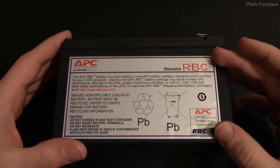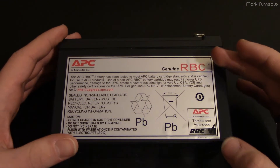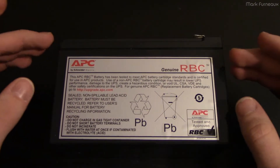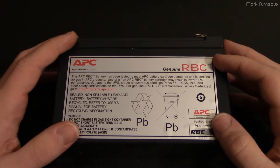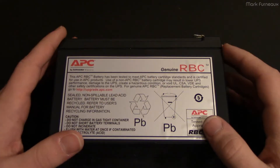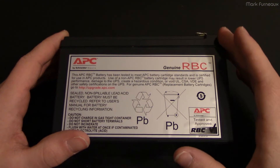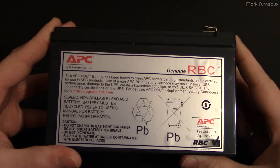What I'm more a fan of is to take the battery out, replace it with a known good battery, and then test the battery you took out. You can swap batteries in UPSs while they're plugged in — I know every manual says don't do that, but that's basically them covering their ass. You can absolutely change UPS batteries in consumer UPSs while they're plugged in. Doing it within about 10 seconds leaves you with no more than 30 seconds total where the battery is disconnected, which is an acceptable risk.